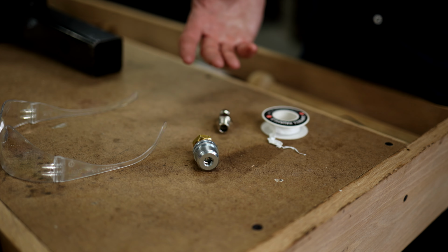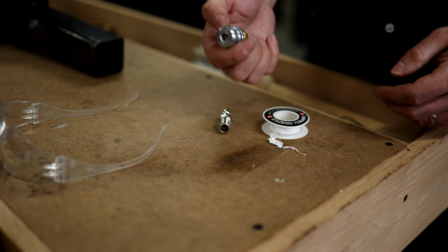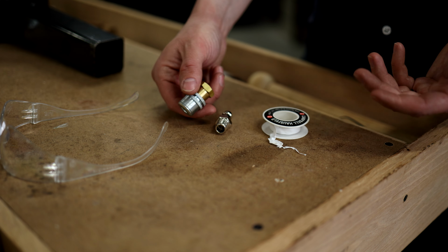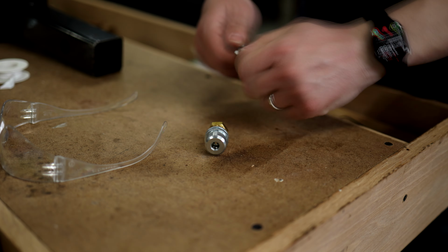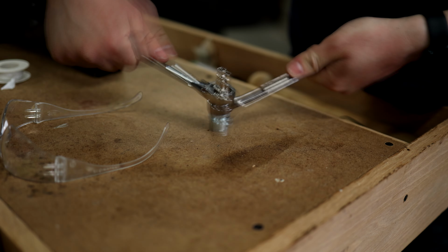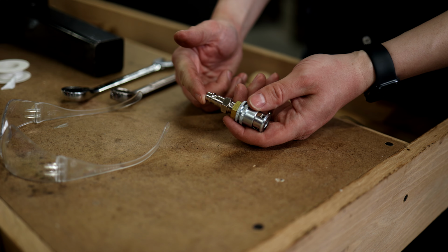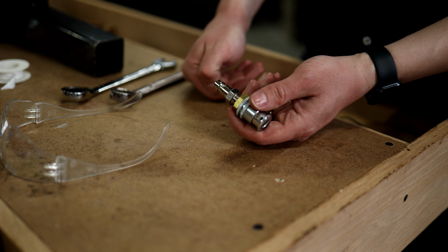For establishing the bead and filling the tire up after changing it, 65 Ford recommended this locking chuck, but it wasn't clear to me how you hook this thing up to air. I think it's as simple as this. So now I can lock it on the tire and then plug my air hose into the end of it, and when it's full, just quick unhook it, I guess.